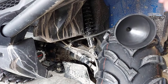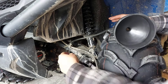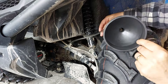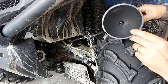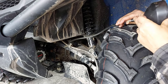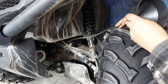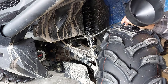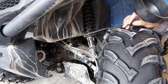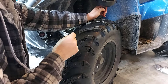Okay, here we are at the front. Like I said, it's a hex socket and I backed out the bolt. That hole for the diff is smaller than the rear one. Luckily I had some clear plastic hose here that fits into there, and a smaller tip funnel. The hose fits on the inside not the outside, so I'm not sure how this is going to go — it may just pour out between the funnel and the hose. But I've got some things to try. I'll fill it up and put the bolts back in.